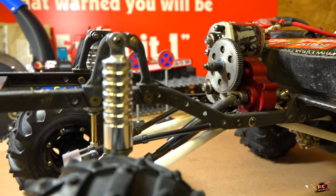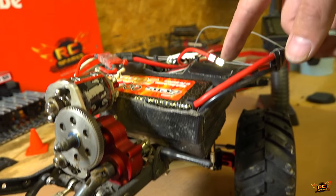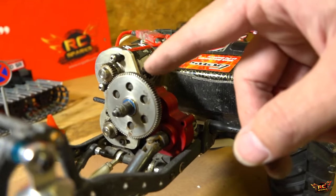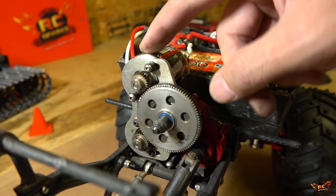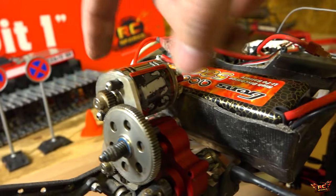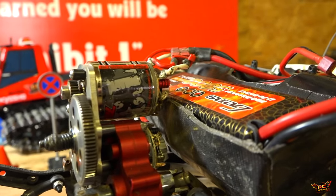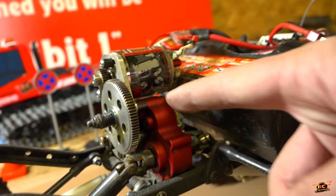Down to the old frame I've had forever. These are side-mount posts for the body — I don't actually use top clips or back clips with the Clodbuster body. Moving up the driveline, it's a Punisher driveshaft from RC4WD, a Robinson Racing Products 92-tooth spur gear at 48 pitch, a Level 3 RC dual brushed or brushless motor mount plate, and a 24-tooth pinion on each side because I'm running dual Teken 35-turn brushed motors.